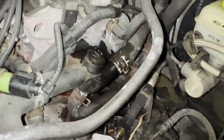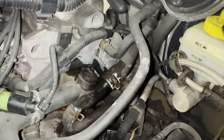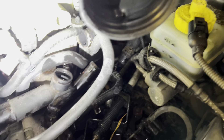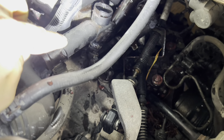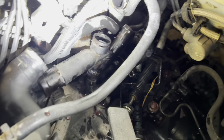We're going to go ahead and start removing the hoses. You have three: one in the front, one in the back, and one down there on the bottom. We'll go ahead and get those out of the way. You will get more coolant, so just make sure you have a bucket ready. We got the back hose unhooked and the front hose unhooked — we did lose some more coolant, so you're going to have coolant everywhere, but don't be afraid of that. We have one hose left on the bottom — it's a little stuck — but we got the clamp off and we'll get that one off and move on.